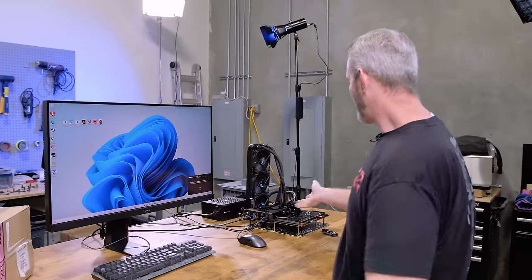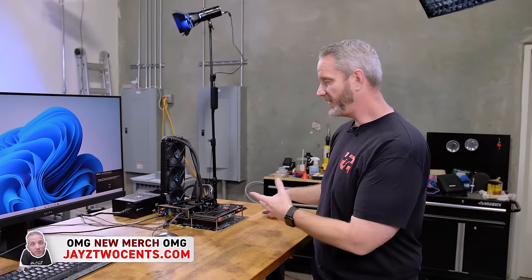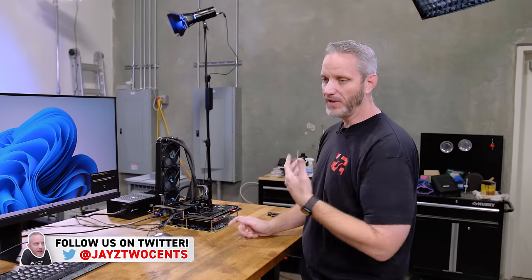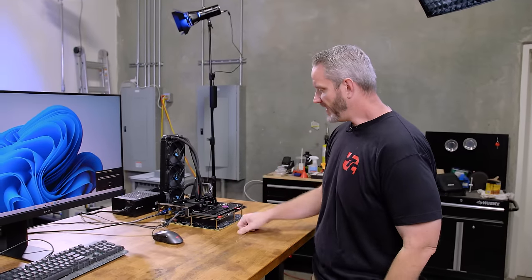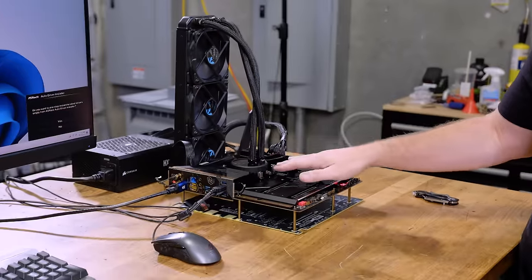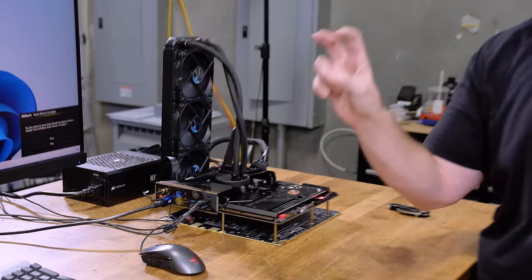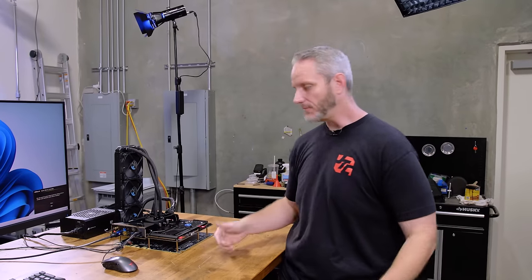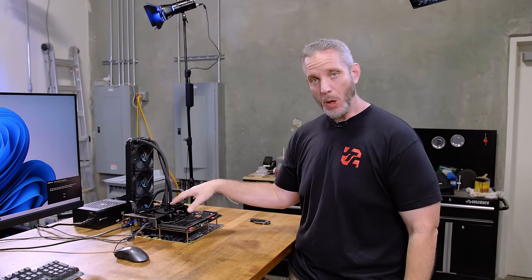Now, since I have torn the system down, and had to rebuild it again because I thought I was done with doing this with the Tai Chi board, but I'm not, so here we are again. I've had to remount it, I've had to repaste it. You guys have seen that video. If you haven't, go and watch it because it shows some of the trials and tribulations of modifying the CPU with the AM5 socket being AM4 quote unquote compatible because of the Z-axis height for the mounting options. I went through quite a bit of testing to find where I could have it mount properly.